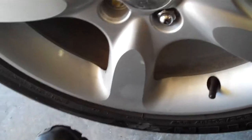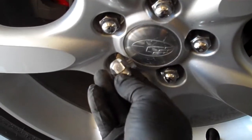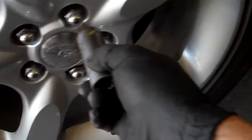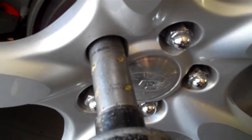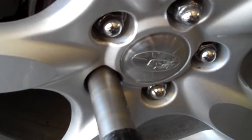I like to tighten the bottom one first. See where my foot's holding the tire? If I let go, it's floppy. Do the bottom one and hold it until you get it done with the air ratchet. Now when I torque — everybody asks how hard to torque them. I do the star pattern: tighten opposite sides, and watch that socket slow down, then just tap, tap, tap. That ensures you get a good even seating. These are 19 millimeter on almost all Subarus, by the way — three quarter inch.